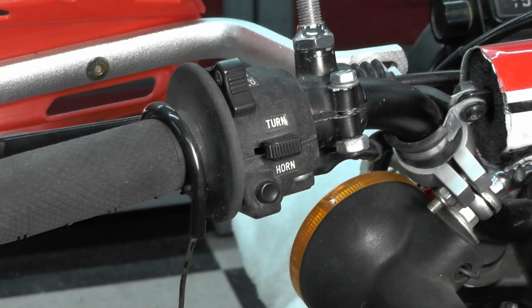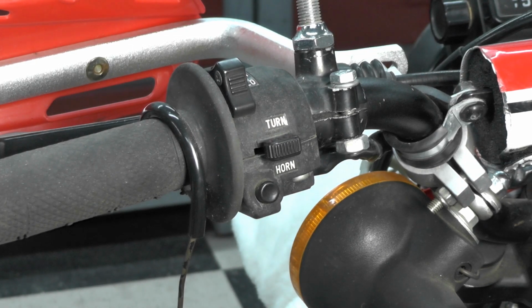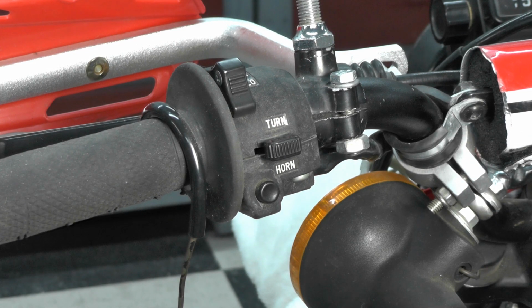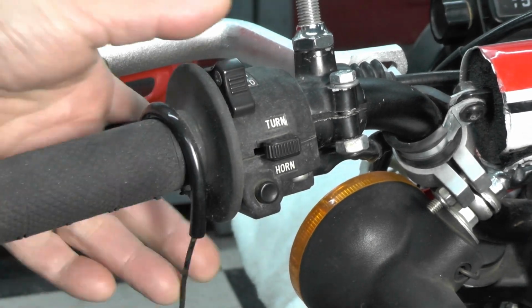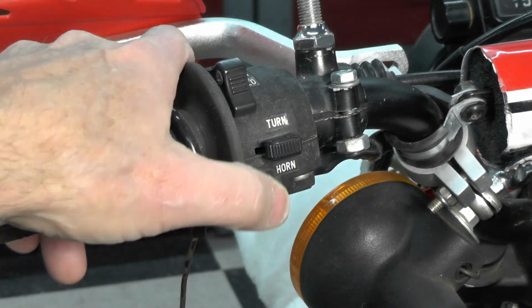And what I discovered, and I really just stood here and looked at the setup we've got, I thought, these handlebars, I wonder, because they're painted, if they're aftermarket. So I went online and did some brief research, and what I found is that most of the XT250s of this era I saw in photos, or at least many of them, had chrome handlebars. I did see a few from time to time that had black similar to this. My conclusion is these are aftermarket handlebars. The originals were chrome, and of course you can get a contact and a ground through chrome, because it depends on this clamshell getting a ground to the frame for this horn to work.